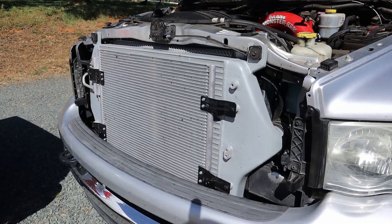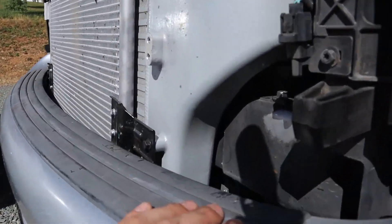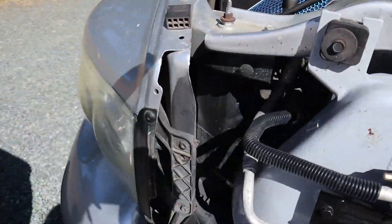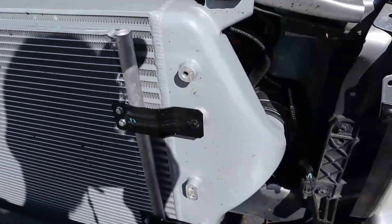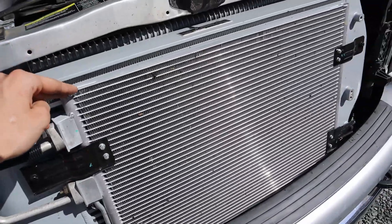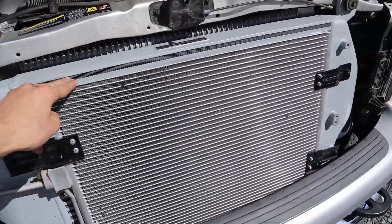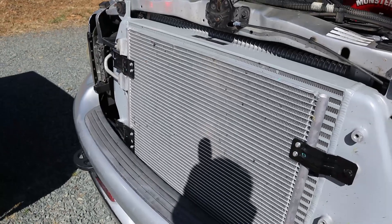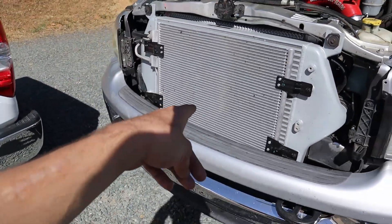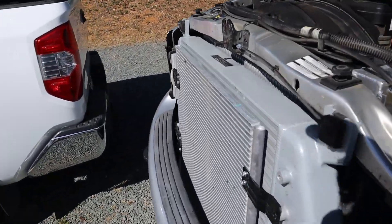Sorry guys, camera died last night when we were finishing it up but we installed it really quick. With the intercooler it's pretty much just come in at an angle - you have two hangers on the inside that hang on the bar, then just line it up, get them in your hoses. I put a little bit of lube on the inside so it goes on nice and quick. We also stopped at my buddy's shop and extracted the refrigerant out of the AC system, swapped out the old AC condenser, put a new one in - I'll have the brand in the description. I got a silver one to stay with the Mishimoto color scheme.